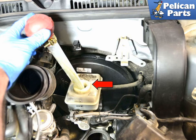The caliper is now ready to install new pads. Installation is the reverse of removal. You may also want to spray the back of the pads with some anti-squeal paste — this paste basically keeps the pad and pistons glued together and prevents noisy vibrations. Some brands of pads may come with anti-squeal pads already attached to the rear surface, or they can be purchased separately as peel-and-stick sheets applied to the rear of the pads.